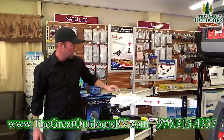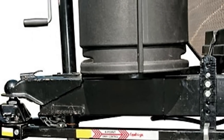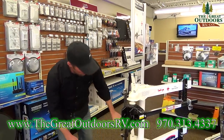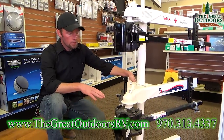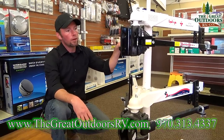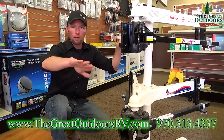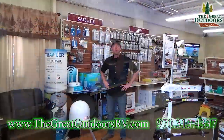Right behind me — something I definitely recommend for any travel trailer — is what's called an equalizer hitch. It does two things: it equalizes the weight off the bumper of the tow vehicle and provides sway control. I carry two styles: the E2 Fastway, which gives you 400 pounds of two-point sway control — back and forth — and above that the E4, which gives you four-point sway control, handling back-and-forth movement as well as the pivoting of your trailer while towing.